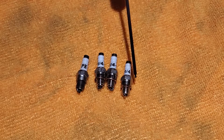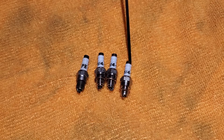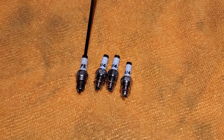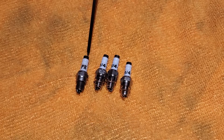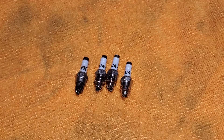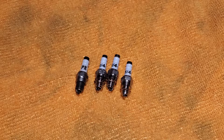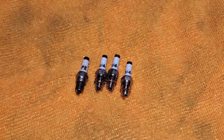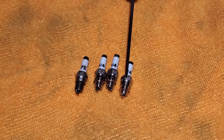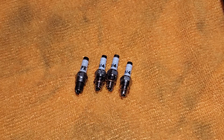Otherwise these three plugs were manufactured in batch and passed whatever quality control standard was set by Horizon Hobby or RCEXL, and the generic ones are just the plugs that worked but couldn't pass the stricter quality standards — that's how a lot of generic items work these days. These are all 1/4-32, they all fit in the engines, and I will be trying some of these branded plugs out to see what kind of results we get.